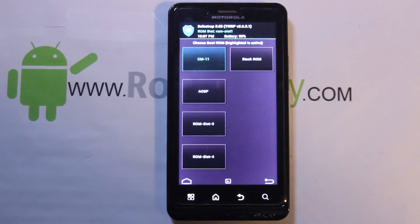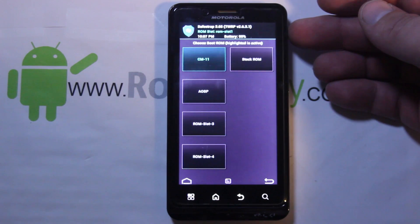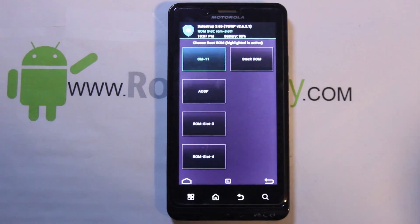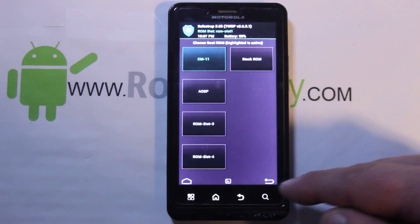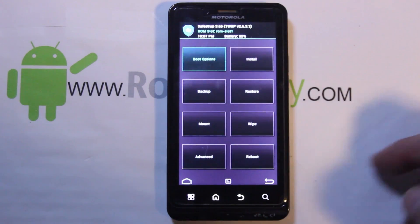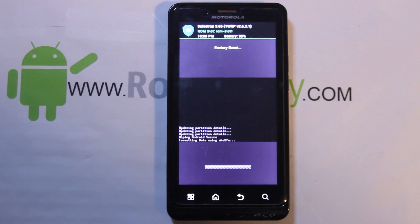We're going to go to Boot Options. I'm going to click on a ROM slot that I already have activated — you can see I already named it CM11. It's really important you have good battery life; you don't want this thing shutting off in the middle of flashing. So we're activated on ROM slot one. Go to Wipes, wipe across, and wait for it to finish — it's doing a factory reset on that ROM slot only, not on your stock system. That's the whole point of Safe Strap.